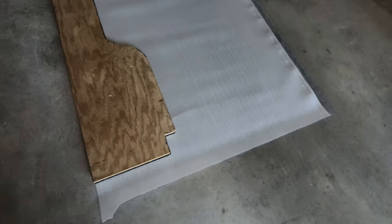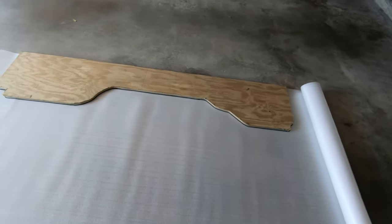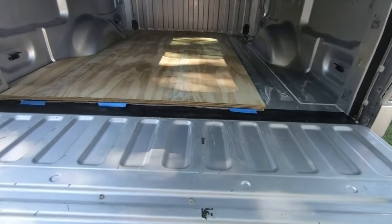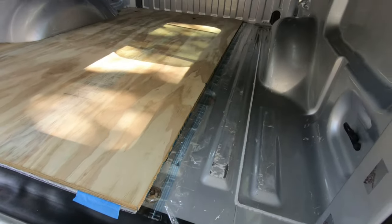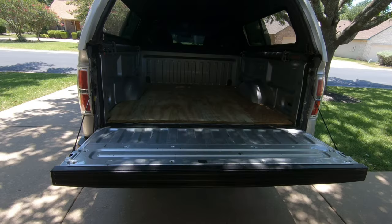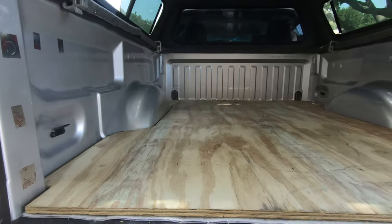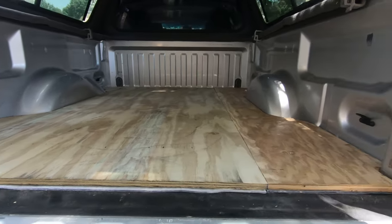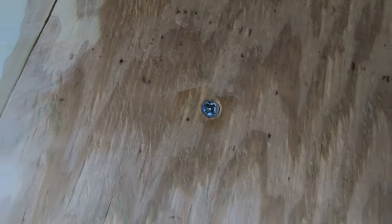With this truck build, we decided not to go with heavy insulation because the van was always super hot in the summer — it was amazing during the winter but we just couldn't stand it in the summer. So we're going with a lightweight, really just a noise-canceling underlayment for this truck build. This is a Traffic Master underlayment product from Home Depot and we're tracing out the size for the bed side. Here we're looking at the large plywood subfloor with the underlayment already under, just about ready to lay down the smaller side. For the Astro Camper Van we used sheet metal screws, but in the truck we used bolts — a total of 10 bolts, as it's very hard to find access points from below with a lot of things in the way.